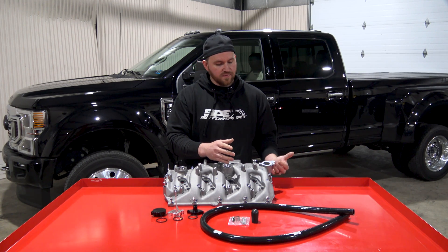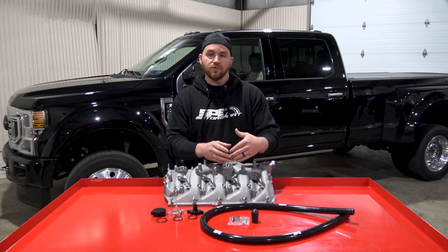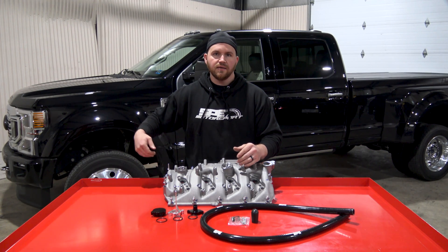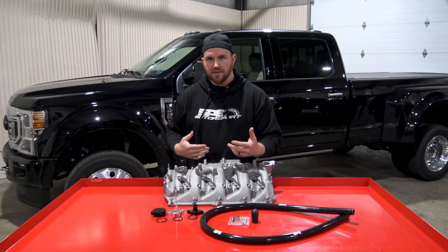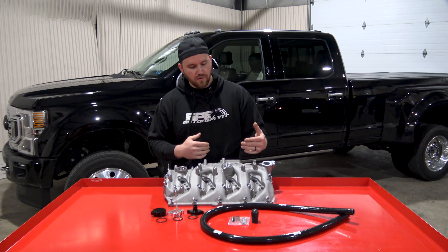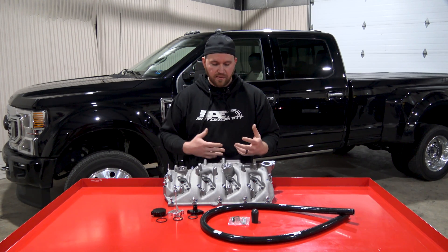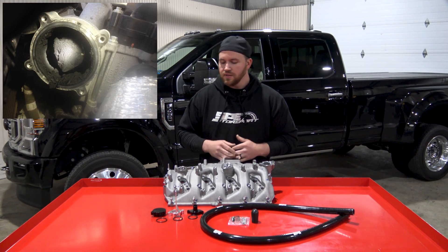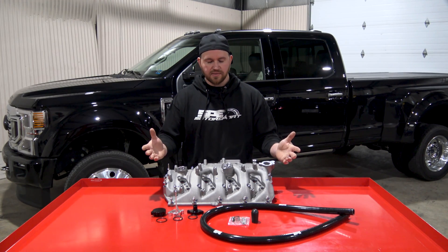After the crankcase vent comes up through the box, your crankcase pressure is going to go through a filter. After it goes through that filter, it comes out of the box and goes to the intake side of the turbocharger. Basically all that oil and vapor gets sucked back into the engine. It's an emissions-based process — it re-burns the oil and fumes, and it can cause oil deposits on the intake track, which obviously is not great for the health and longevity of the engine.